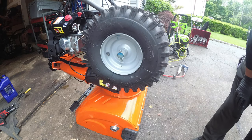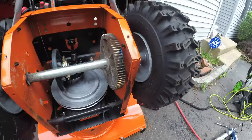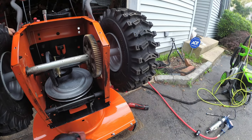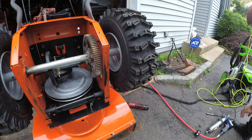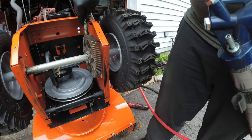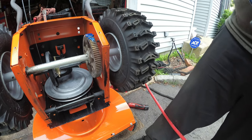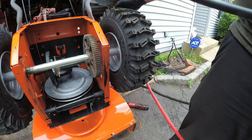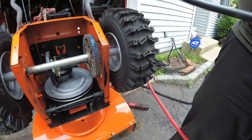Okay, that's that. Now the last part to lube up with grease is our sprocket. Now, anything that's metal on metal, I like to grease up. Obviously it keeps the friction down. So let's do it. Just use the teeth to our advantage. That's it. Alright, see that? And just spin the wheel. Don't spin it fast because then remember it might spray it. So just rotate it around. You see how it's going through the sprocket.